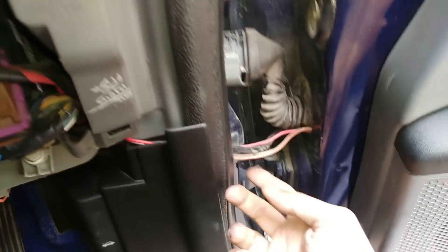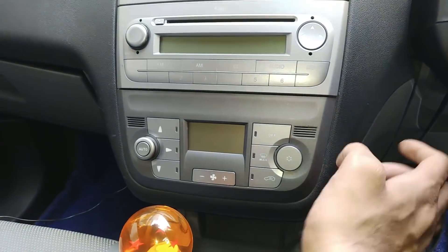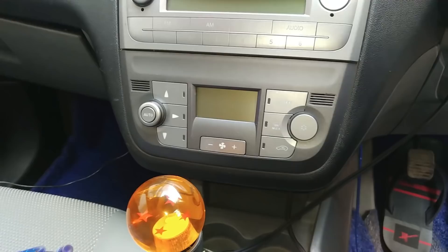The speaker connectors are in the door, so we have put the wires inside the door — there are multiple wires there. I will cover component speaker installation in the next video. There is already a video on coaxial speakers, so I'll give you a link to check that out. There is also a previous amplifier installation video linked at the start. Now we are going to remove this old wire and install the RCAs, then the remote wire, then connect everything to the amplifier. I'm also planning where to mount the bass knob.